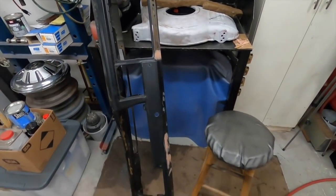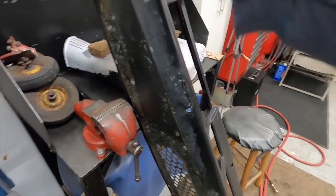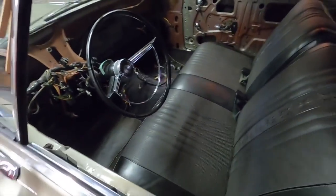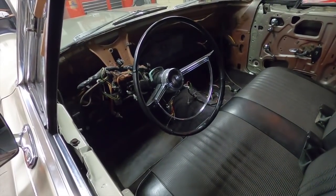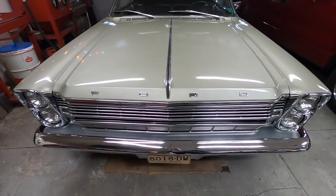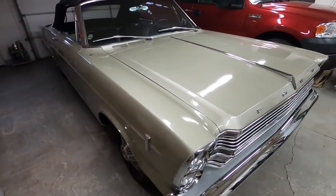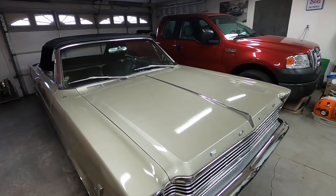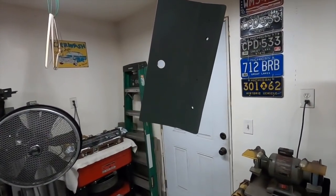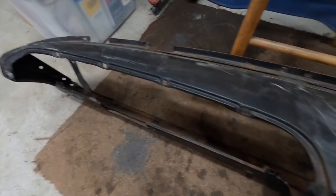Both the ashtray and the glove box are ready for paint. I'm going to get this ready for paint and then maybe tomorrow, if it's not snowing in my paint booth, I'll paint it. I could paint it in here but I'd have to connect the battery and I don't want to do that with all this wiring harness hanging here. I'll just wait for a good day or cover the car up and back the truck out. I want to let this primer dry up so it doesn't get dirt stuck in it, and I cleaned all the adhesive off so it doesn't load up my sandpaper.